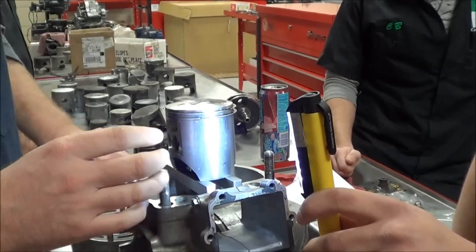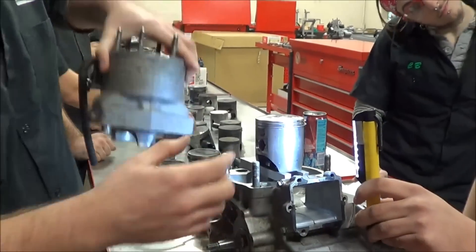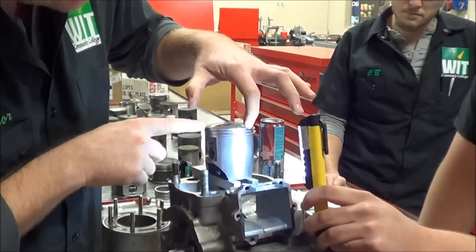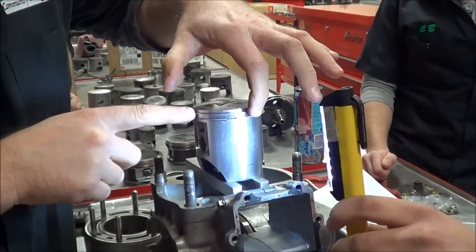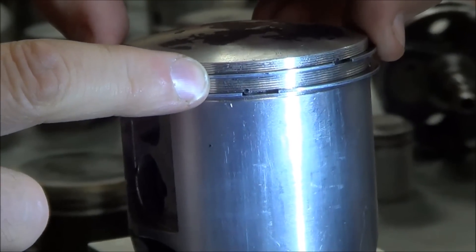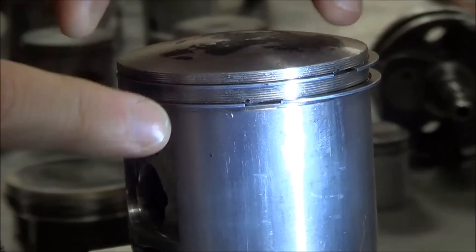If we miss and we have this big, heavy 15-pound cylinder pushing on that ring — look at it with my finger with next to no effort. Do you see how I'm walking that out of the groove? It's never going to go in there. I've got to make sure that I'm in the piston ring groove and that I'm going to be around that pin.